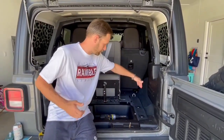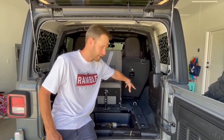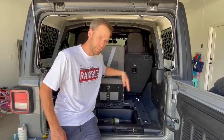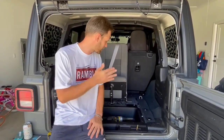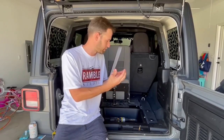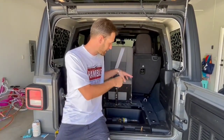We're going to use two outside bolts on this side, one outside bolt here, and due to the coil spring bucket, we're going to have to use an inner bolt in the back — but it should all work out good. Now all we need to do is start our first hole. There's an access hole underneath through the subframing structure, and I want to start dead center of that, so I'm going to drill up through with that one, get that set, and then we'll be able to measure out for the rest and mark them.